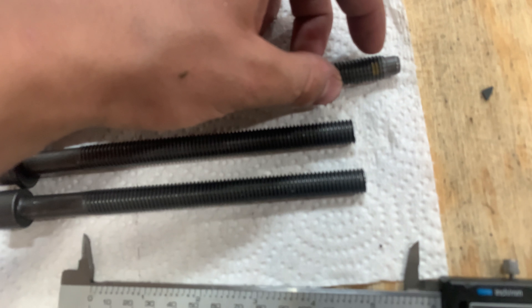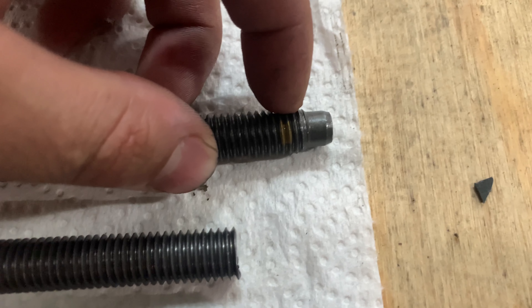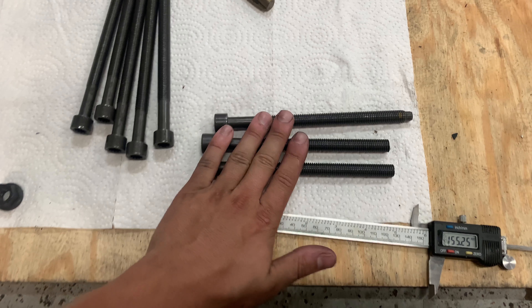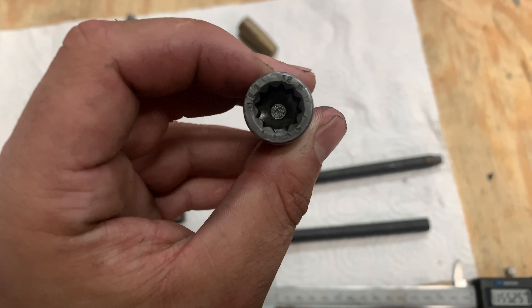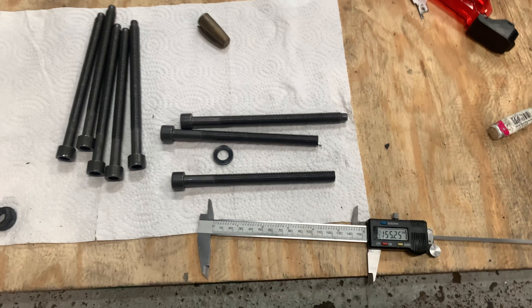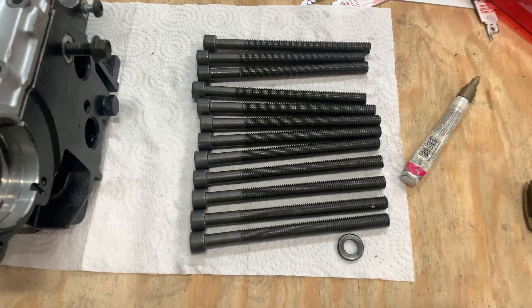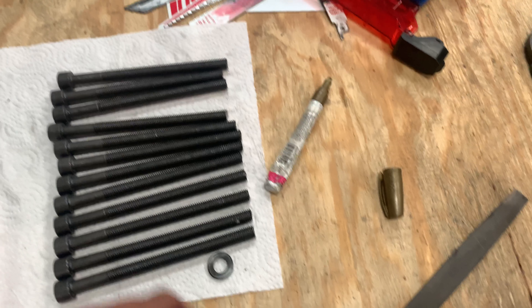With the ARP washer on, cut the length from here to the end to about 155–157. I went with 155 — I want it a little shorter to give myself a little bit higher tolerance. As you can see it's basically perfectly on at 155. If you count the threads, you want to cut between threads three and four and that'll give you the perfect length. Then use the ARP washers. We're going to use the Volkswagen spec — these are grade 12.9 bolts. The Volvo are 10.9, so these should be a lot stronger. You have to use a special triple square socket.